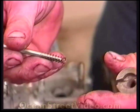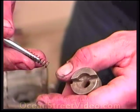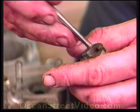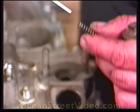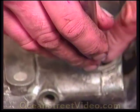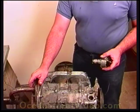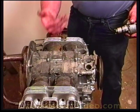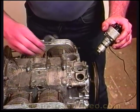In order to put that spring in, I put an end to something — in this case I'm using a little punch or drift. I'm going to slide it in like so. That way you can guide it straight into the hole without it falling anywhere. Guide it in, hold it down, pop it out. In order to keep the drive gear from popping up as we turn the engine over, I'm going to go ahead and put a distributor in here to hold it down and clamp it in place.